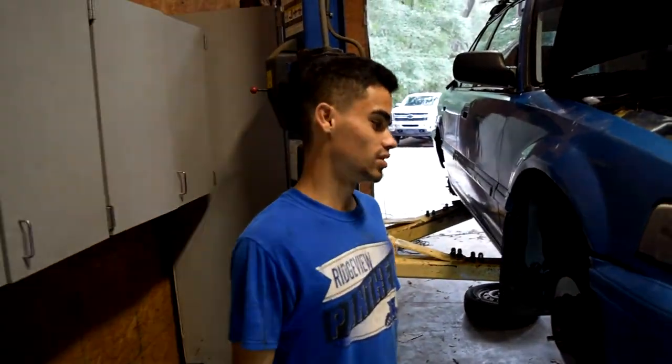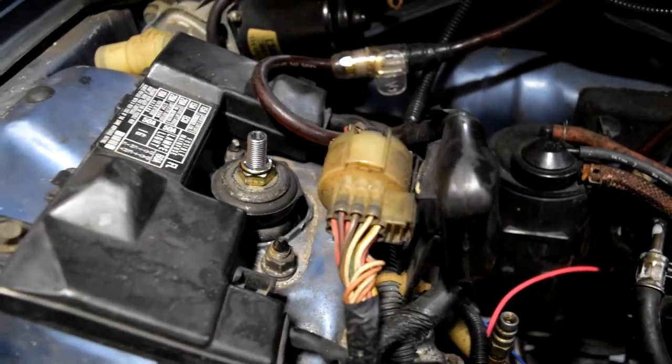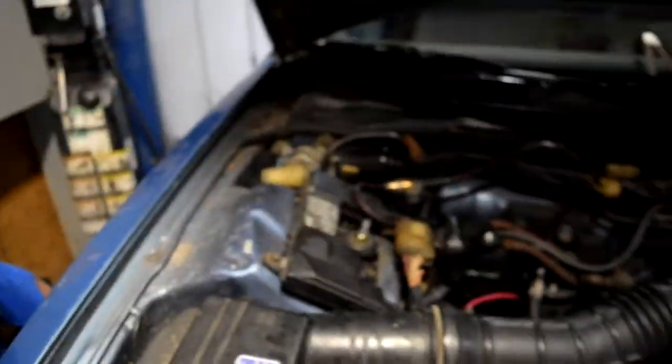So it always is. I had it done in maybe 30 minutes to an hour, to an hour 30 minutes, maybe, knock on wood. All right. Well, the problem was these two nuts up here on the top hat weren't tight. There it is. They were just hand tight, and it let the strut sag, so we couldn't get it on. But you just tightened it.